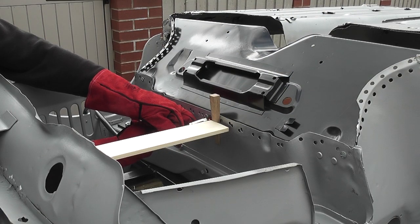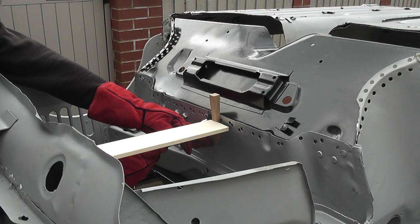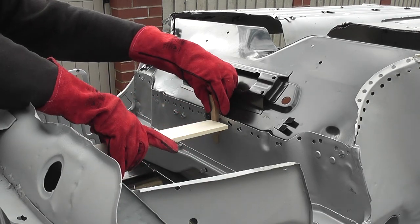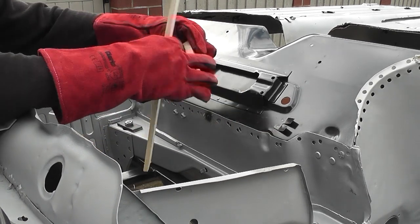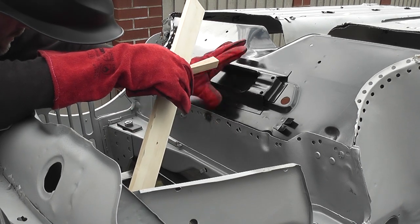But that's when I realised I couldn't actually weld, and to top it off it started pouring down again. It was at this point that I phoned up Dennis from Classic and Retro Restorations to give him an update on the progress, and this is when I realised I'd made a huge error. For a good strong weld you need clean bare metal, aside from the weld-through primer. But what I'd done was forget to remove the paint from the tow board and I'd simply sprayed weld-through primer over the top of it. It was a really stupid mistake and it's set me back quite a bit, as I've now got to remove the tow board and prepare it properly. But on the flip side, Dennis has given me some good pointers and hopefully within the next couple of days I'll have finally fitted the tow board to the car.